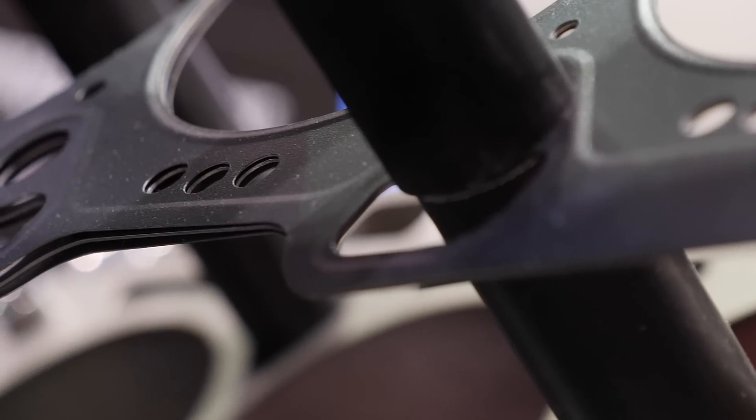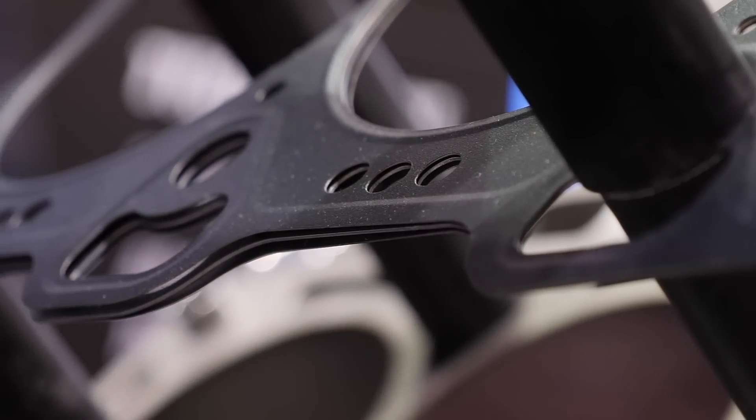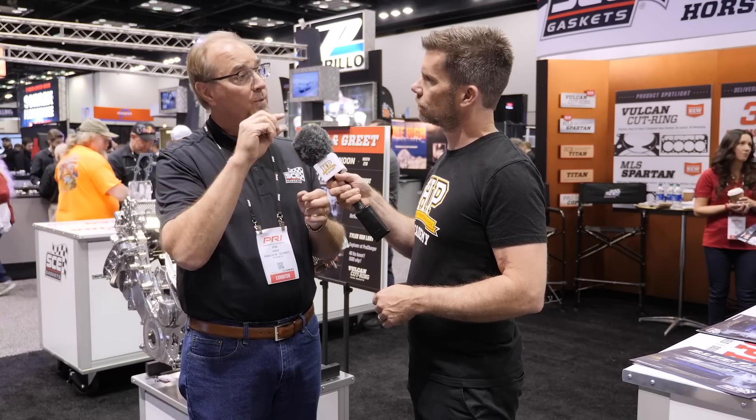A common question is whether MLS gaskets can be reused. With a composite gasket, once the head's been removed and the engine heat cycled, it's basically destroyed — you have to scrape it off and replace it. MLS gaskets generally come off pretty intact, but reuse is a definite maybe. You need to inspect the gasket; if there's still good sealant around the combustion seal area it could be reused, but if the sealant has been scrubbed off — which is fairly common — it's not recommended, as the gasket would be physically thinner and clamp load would be lighter in that area.